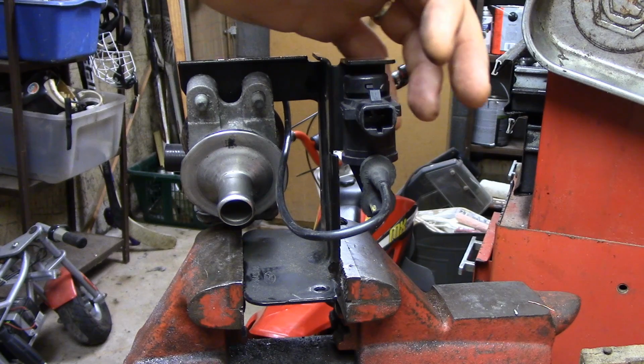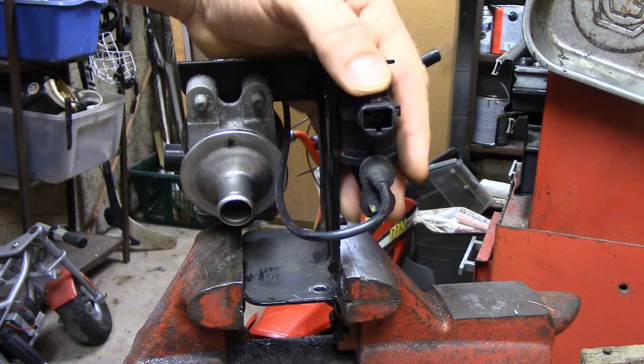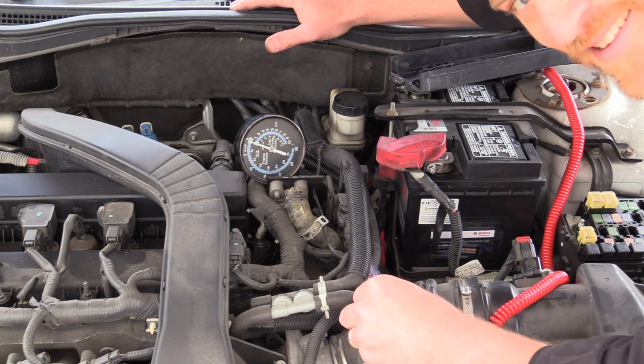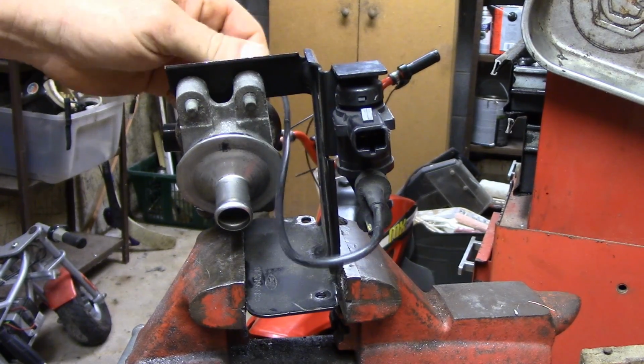You could see when I first put the test light in, it would, because the bulb was cold, and so there's a little bit more current flow at that point in time. And then if I held it on there, or pulled it out, put it right back in while the bulb was hot, you could see that there was no vacuum there.